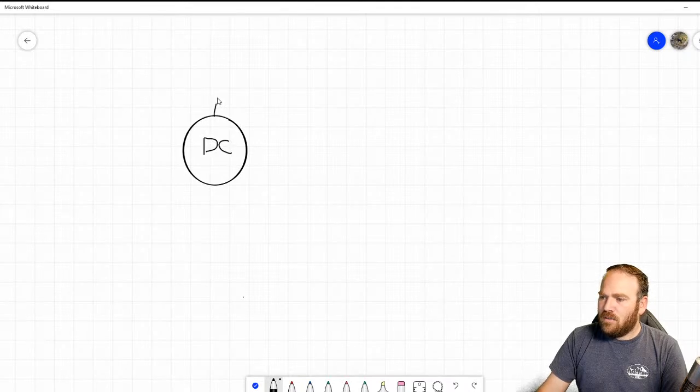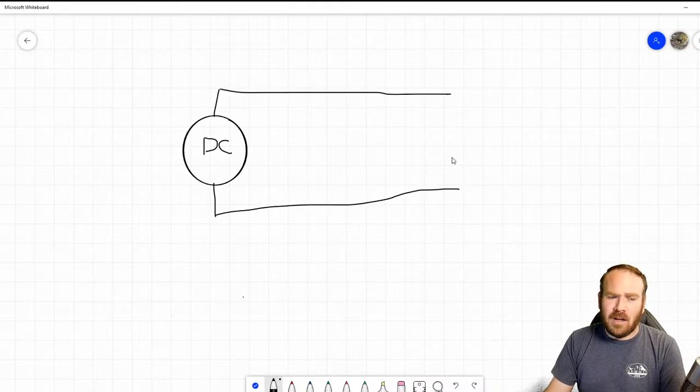So we have two wires going into this. Now, normally on a DC motor, you have a power and a ground. This isn't the case on this motor. They can flip-flop. So we normally run our wires over to a computer of some sort, throttle body control module, and inside of that computer, we are going to have a couple of transistors. I'm just going to build it as one transistor, even though there's normally two transistors in there, one that can pull it to power, one that can pull it to ground. So in the neutral position, this is just going to go straight ahead.